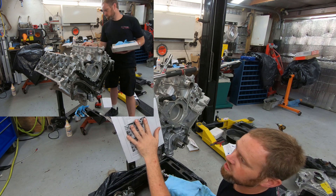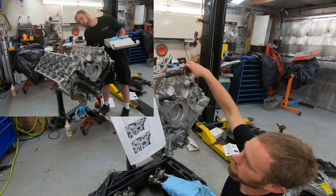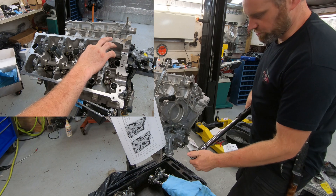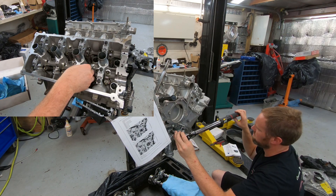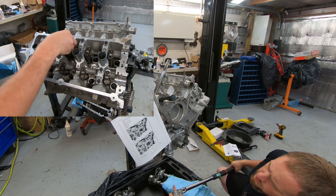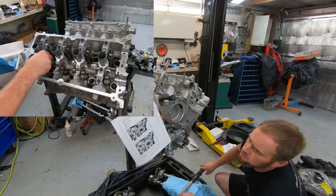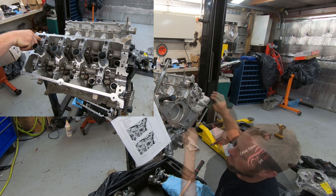The next stage asks me to take B at 75 degrees. Luckily B is 18 foot-pounds, so this ratchet can handle that. This is a very strange torque sequence, I have to admit. We've got 75 there. Now we need 45 on C, which is another 89 inch-pound bolt — so we do the same thing as the last one.